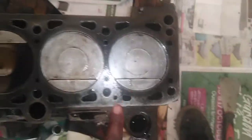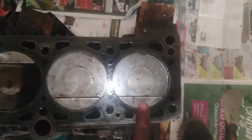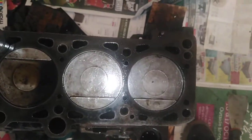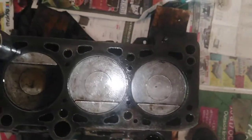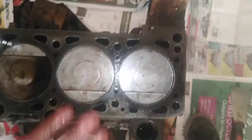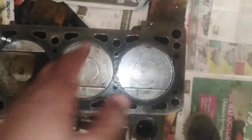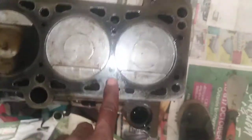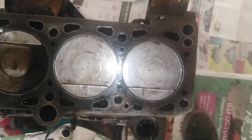We got our cylinder in. Just simply tap it, tap it, tap it as you're pushing the cylinder down and it will get in. Very important again that you do not hit those rings - just push them, push the other side, then it will get in. If you hit them you're going to damage them, then lubricate them again and you'll be good to go.